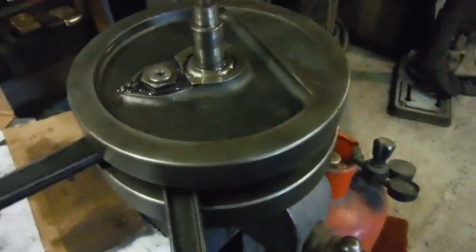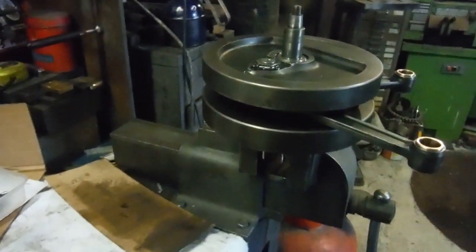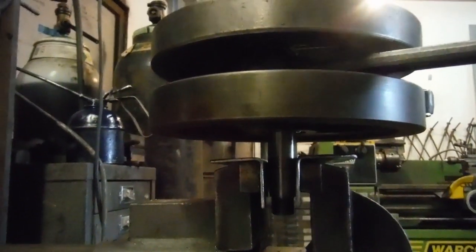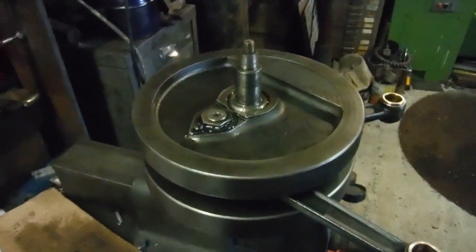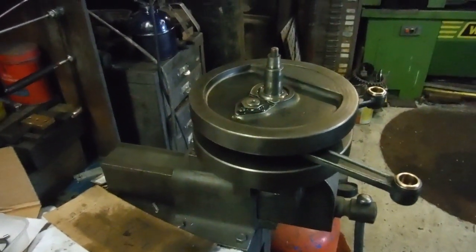So they're going to get their oil — no problem, no questions. That's another very worthwhile check on a crank assembly like this, just to make sure that the oil holes between the crank pin ends and the flywheels are all lined up and oil is able to pass right through. And in this case, it can — so that's all good.